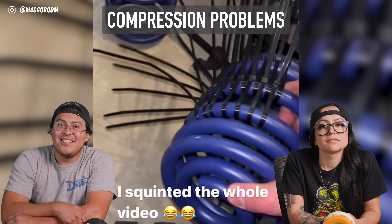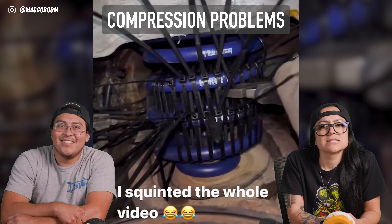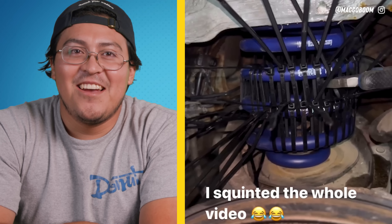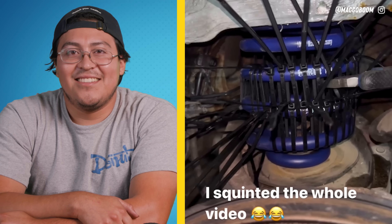You take your angry little ball of zip ties and potential energy and just slot it in. Then with the spring in situ, you just go to town with the wire cutters. That's one way to do it — quick. Normally you'd just disconnect whatever you need to, get a jack, put it underneath, get it to line up and crush that spring in. Hi, I'm Heber, the mechanic here at Donut. I work on all the cars here — everything gets fixed by me most of the time, and things break here all the time, so job security is great. This looks like it works, but it's a little dangerous. If that potential energy becomes kinetic, it will launch in your face — super dangerous. You're really putting a lot of trust in those zip ties. Buy the expensive ones. If you're going to the 99 cent store for zip ties to do something like this, you're gonna see God.